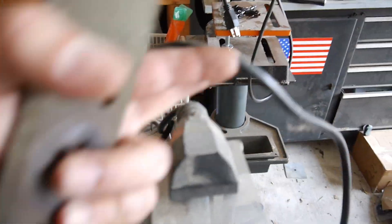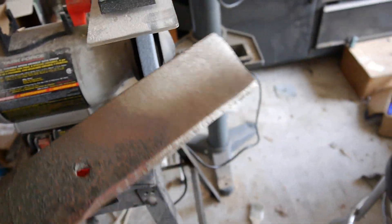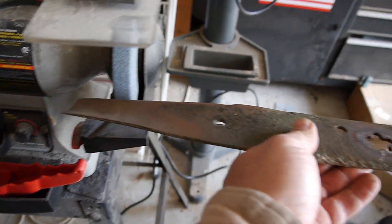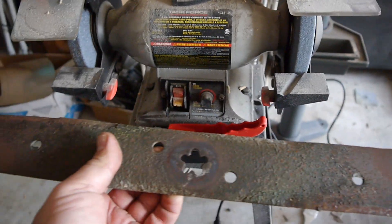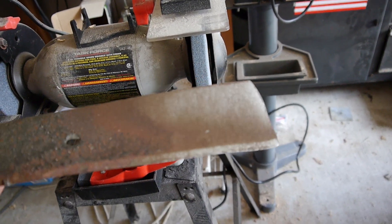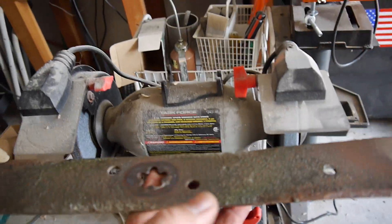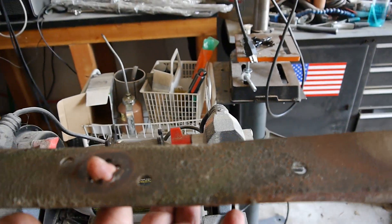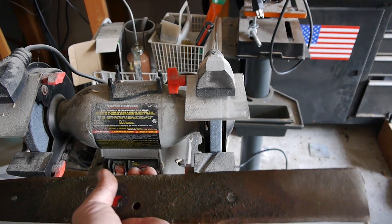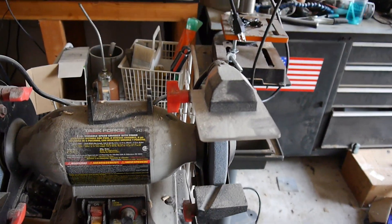So this is where I usually sharpen my blades. It looks like somebody's been doing some woodwork in here — in the past couple of days it's covered in sawdust. I'll go through and sharpen this part of the blade — this one is not bad. I want to take off the least material as I can, and that will keep it in balance. If it was in really bad shape with a lot of nicks and gouges where you really have to grind it down, you're taking off a lot of metal and you're going to have to go and balance the blade. That's putting a center fixture underneath and seeing which way it tilts, and then you can balance it by taking a little off — see those little notches here at the top, where it's too heavy you can take some off here or here, whichever it needs.